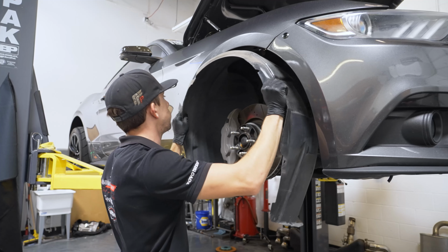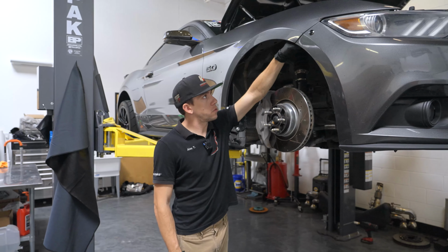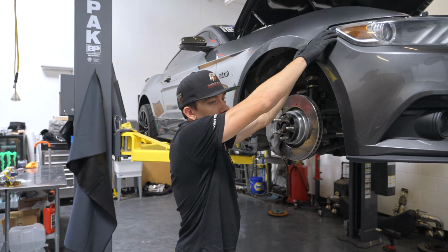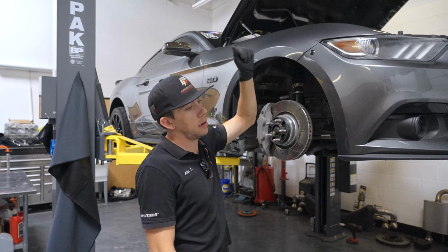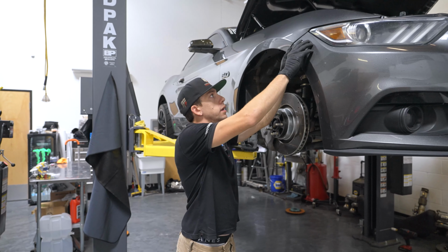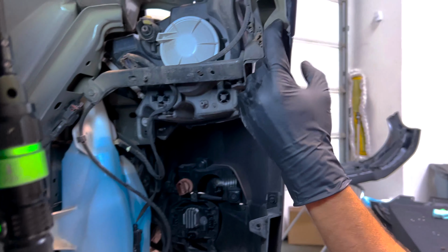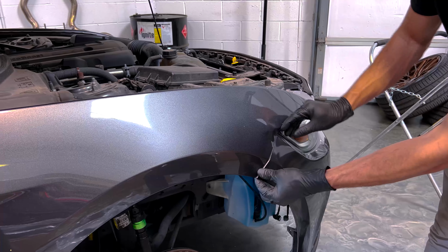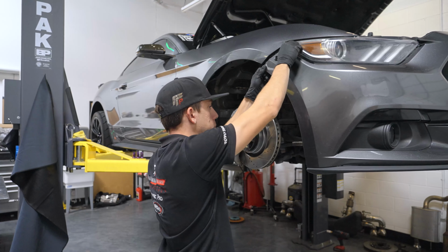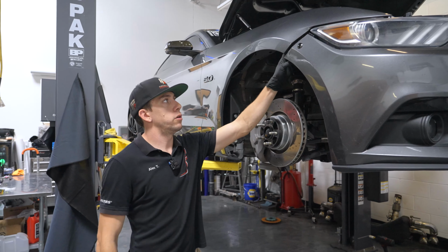So this portion on this particular car we have right here is a little different. On your OE car, there's a tiny screw retaining the bumper right here. It's easy to miss. This will be very tight if you don't remove it, and then you'll yank on it and it'll end up ripping the bumper where that loop is. This car already had the tabs fail, and they've installed quick latches on the vehicle. So I won't be able to show you that, but it's very simple. You remove this one screw in the back, and then you'll just pull this firmly straight outwards, and you'll be able to pop the bumper loose on the top. Other than that, it's pretty straightforward. Just want to make sure we don't miss that.